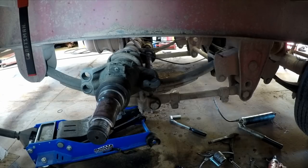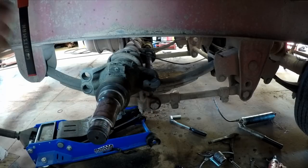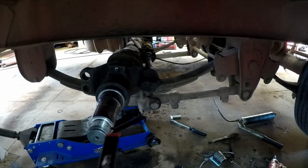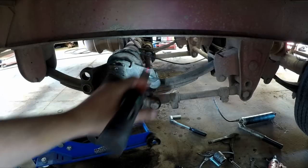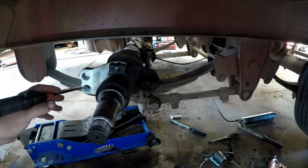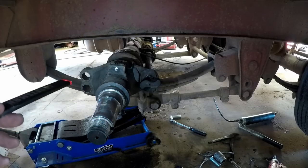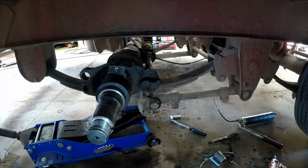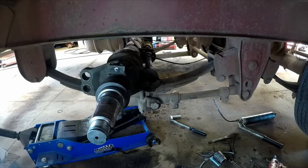I'm back at it — I put a new bushing in the S-cam. I'll kind of show you with the light. I put a new bushing in both ends of the S-cam shaft, and new bushings in the spider on this side. I'm about ready to put the brake together — that's kind of where we're at right now.